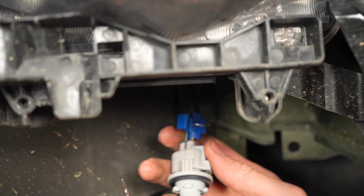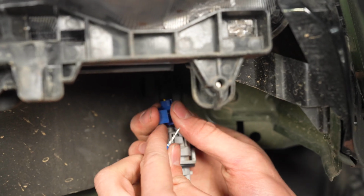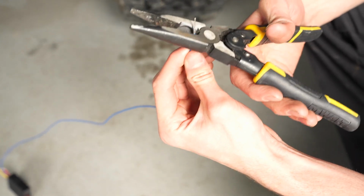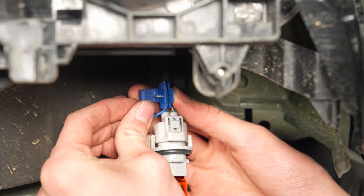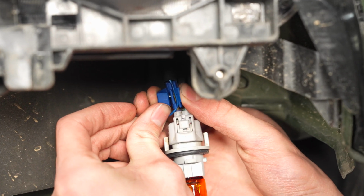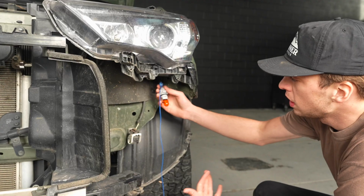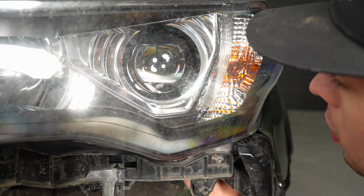And then that's when we'll take our blue wire and we'll cut this top off, and you'll slide it up in there and close everything. Okay, before you do this, we're just gonna cut this little end off, just like that. Okay, now you just feed the blue one through till it's flush at the top, and then you'll go ahead and close your tap. So now this is in, you can just slide this blinker bulb back up into place.